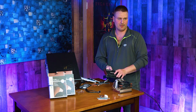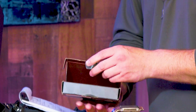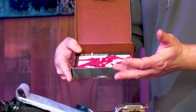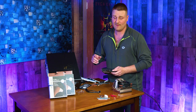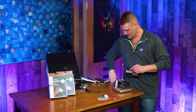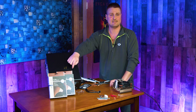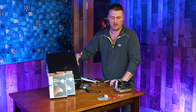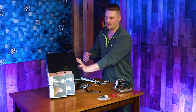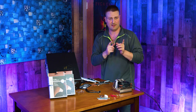To get the front fan to work you have to order these Chromax anti-vibration mounts — you can get any color, I got red. You're going to need three of them for the forward fan. One important warning: I actually saw worse thermals with a fan in the front intake when using a dual-fan GPU. So I'm putting my fan on the rear and upgrading the stock fan — both are 92mm fans.